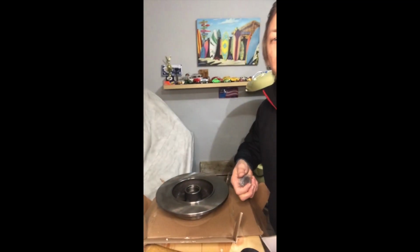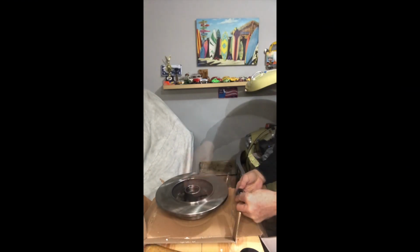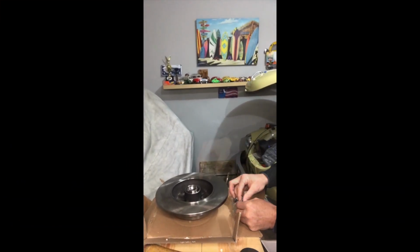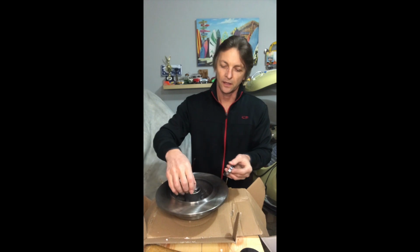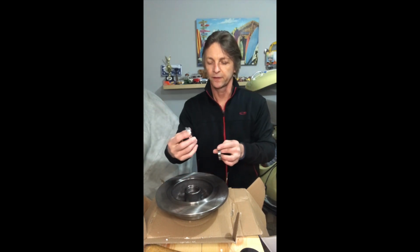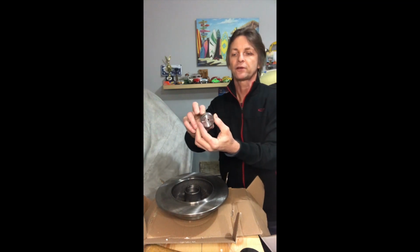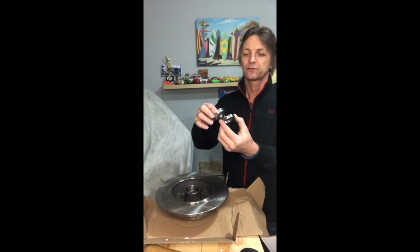So we grab our second bearing here. I'm going to use this little sharp knife. Set that for the time being there. Put these back in here. Now we do the same exercise. We find the best driver that fits here. We can see that that one goes in very easily. So I know this one will be a perfect fit, and not only that, it actually fits over my race. It's got a little bit of play, which won't hurt because it won't damage the inner concave surface of my race bearing.